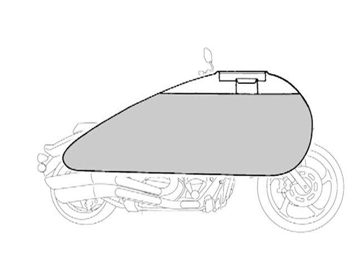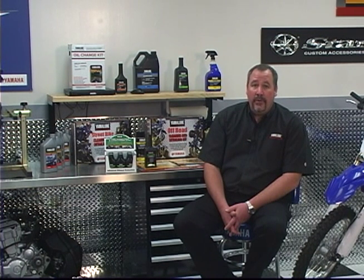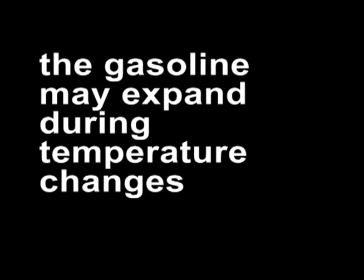Then top off your fuel tank to about 7/8 full and treat that fuel at one ounce of concentrated stabilizer to one gallon of gasoline. Filling the tank mostly full reduces air space in the fuel tank and helps prevent corrosion and condensation. Do not fill your tank completely full though — this may cause spillage and gasoline overflow during temperature changes, which could create a fire hazard.